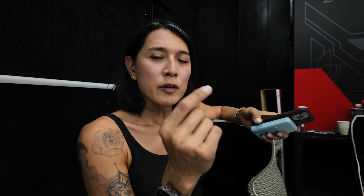RWB Noah has to go under severe checkup for the crank position sensor. It might be the sensor, the wiring from the crank sensor to the fuse box, and then the fuse box wiring to the ECU. So three things to check for RWB Noah. It went back to garage 2233, so the team of Alfredo can help diagnose and see what's up with Noah.